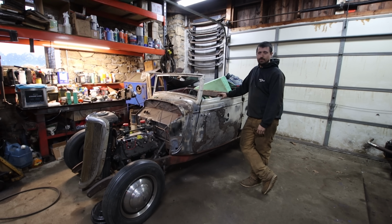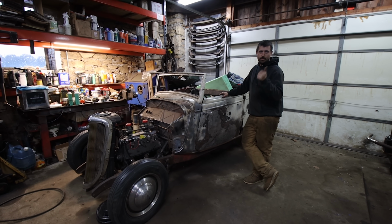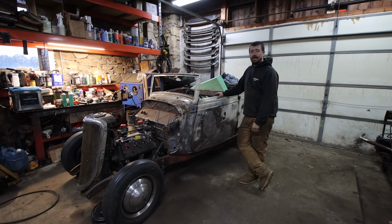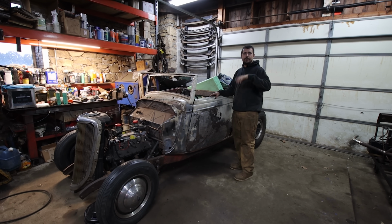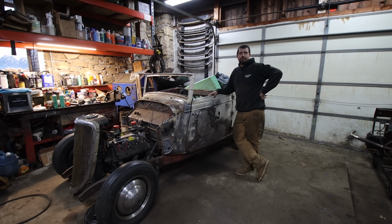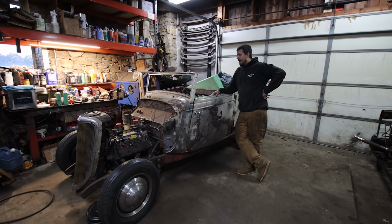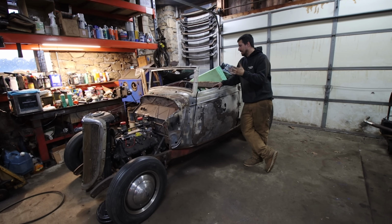A lot of wiring to do. All the gauges are electric, so I need to find all the correct sensors for oil, water temp, that kind of stuff. But they're out of a GMC or Chevy pickup? Yeah, I just got to find the correct sender for it. It's like a '56 GMC pickup. They're probably the same as a Tri-Five Chevy car, which I'm hoping. Yeah, fingers crossed. Hopefully the thread pitch isn't totally different for a flathead, but we can make it work.